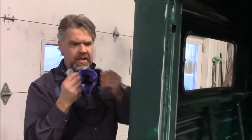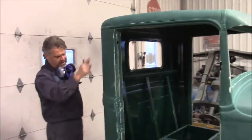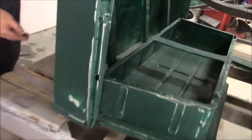Those runs almost contaminate the paint because it doesn't harden properly. So when you sand, it becomes soft in the center and it sands off. That's why we have issues like around the cab corners. As the camera person comes around the back of the cab, these are all paint imperfections or hangers in the paint.